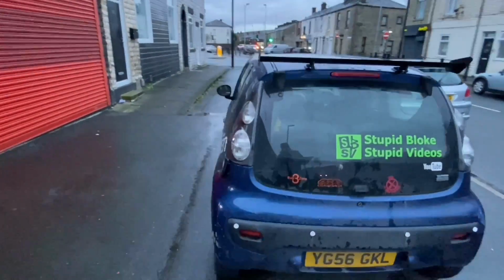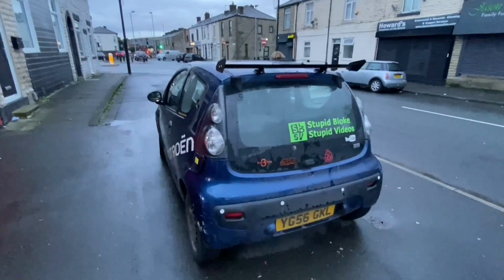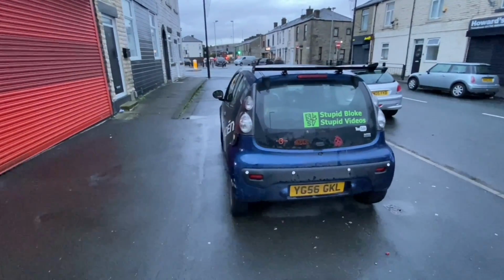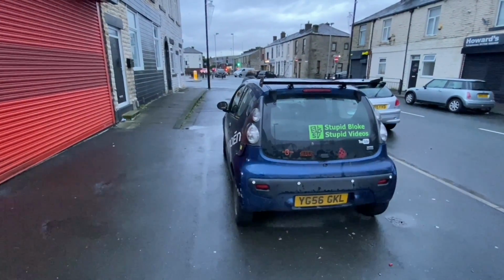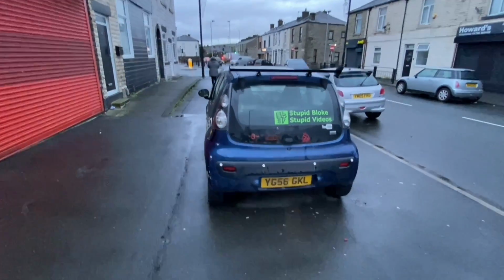I didn't think it'd take as long as it did because I didn't think I'd have to put load resistors in, because those bulbs were supposed to be error free. But other than that, I'm happy with them because they are really bright, and the light out of them's a good colour as well. So yeah, that's it. Like I said, that's it for this one.